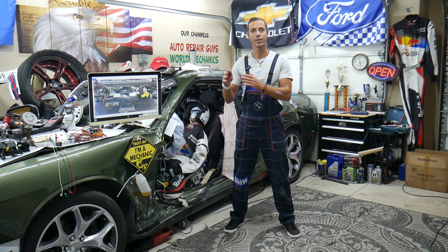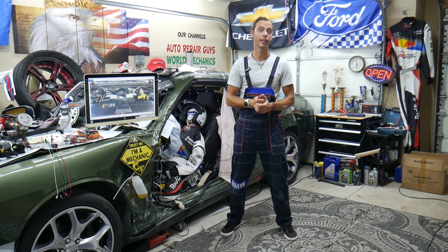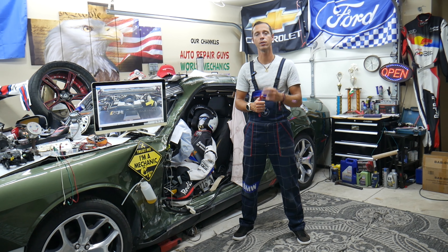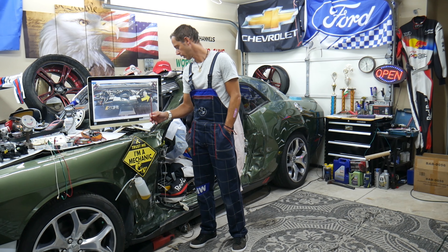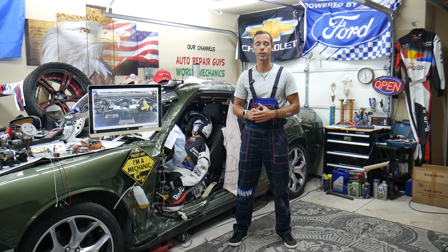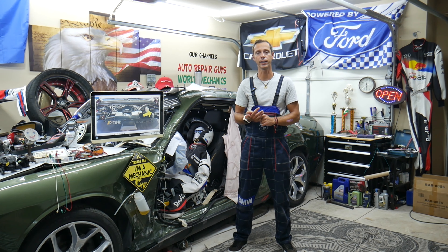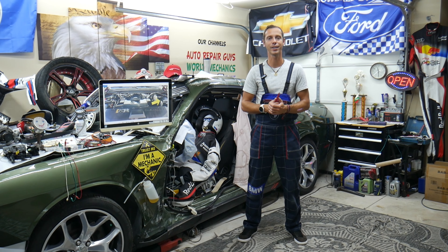What else can cause the radiator fan not to work? The signal wire from the engine computer to the fan — if it's internally broken somewhere, we had a case like that where it caused the fan not to run. Also, we had two cases where a bad engine computer caused the radiator fan not to work — that's possible too. A weak water pump is another thing we've seen that can cause overheating. Those are some of the most common things we see at the garage. It could also be mechanical problems such as a blown head gasket. If you want to know the symptoms of a bad head gasket, we'll have videos on the channel.